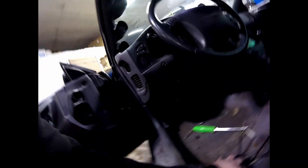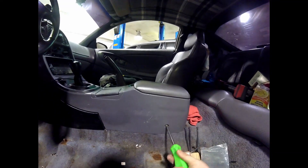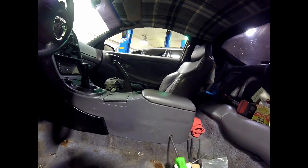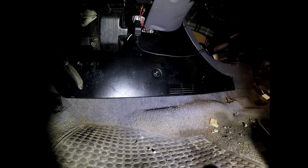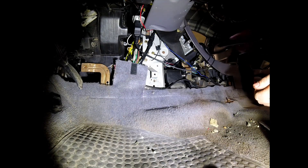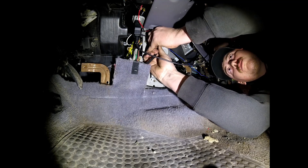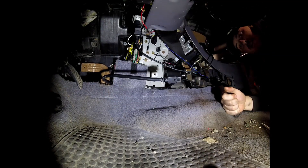Got the seat out. There it is. If you guys got power seats, there's two plugs here on the bottom - this one's for the motor, it's probably the beeper or something. So to get the side panels off here, you're most likely going to have a 10mm there, either a 10mm or a screw back here. As for the 10mm back here, I need to go grab a 10mm. Undo that, this thing should all just pop off, pull her on down.